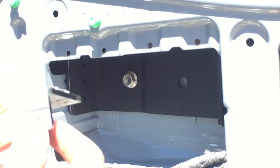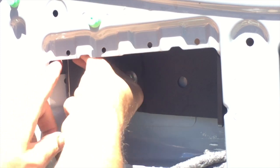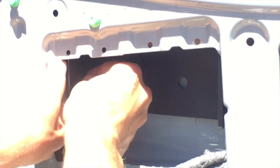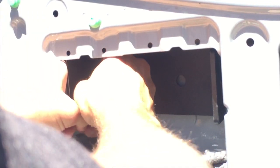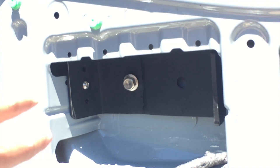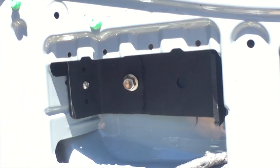Once those are drilled out, that's when these hockey stick-like things come into play. They actually reach over — you grab it by the tab on top, slide it over and behind, and that tab will keep it resting on there so it lines up. Then stick these Allens through. You can try starting one of the bolts a little bit through before you put it back there — then you can hold it with your finger until you find the hole. Try not to cross-thread it. So two in this side and two in the other side — tighten those down. You can even put some Loctite on that if you want. Then you are ready to start with the hinges.